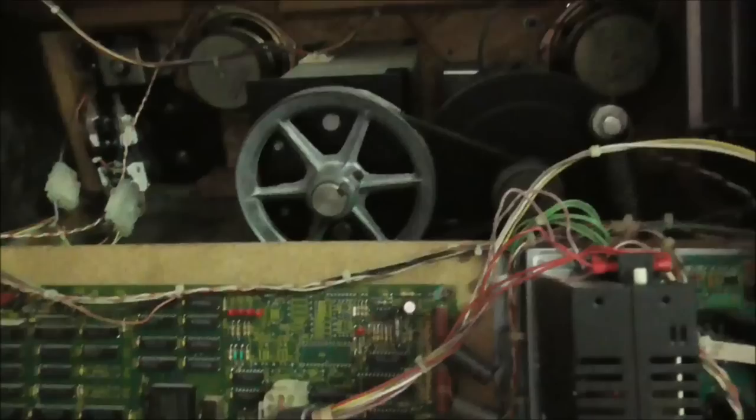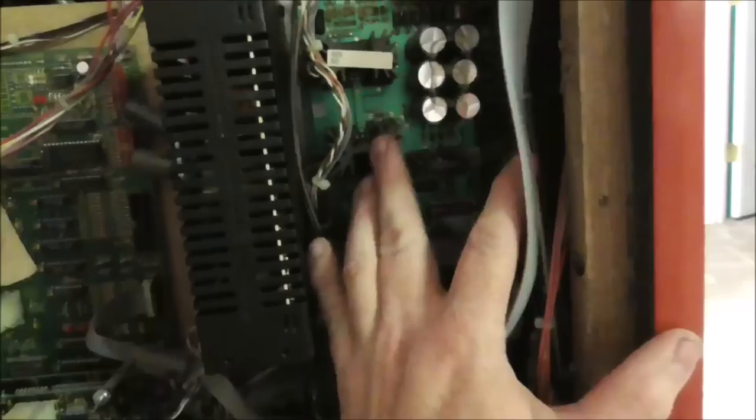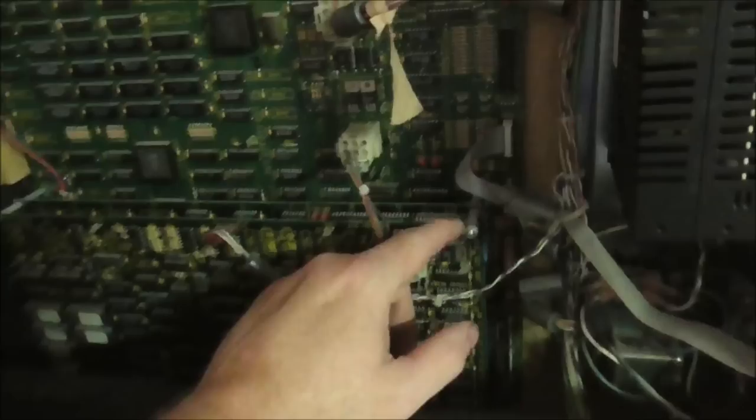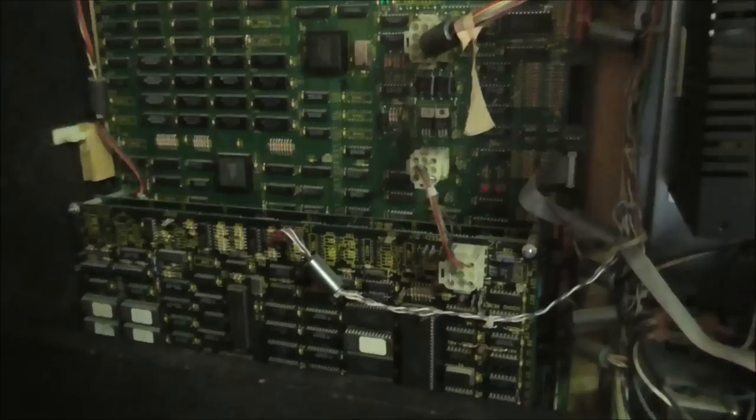They did force feedback a little differently later on. We've replaced the standard switching power supply — this is new. There's what I'd guess is an audio board, a big transformer, some fuses, a line filter, and then the game board set — a big three-board set. One full-size board and two half-size boards. This is the compact upright version; the sit-down cockpit version I believe has an even bigger board set with a fourth board. There's a lot going on — very complex.